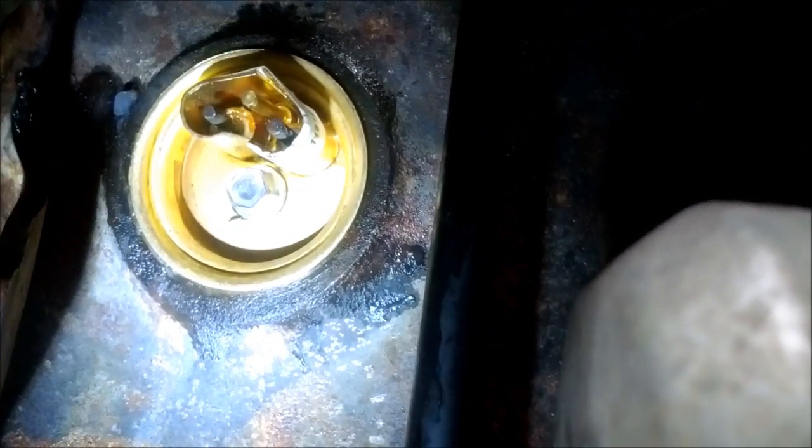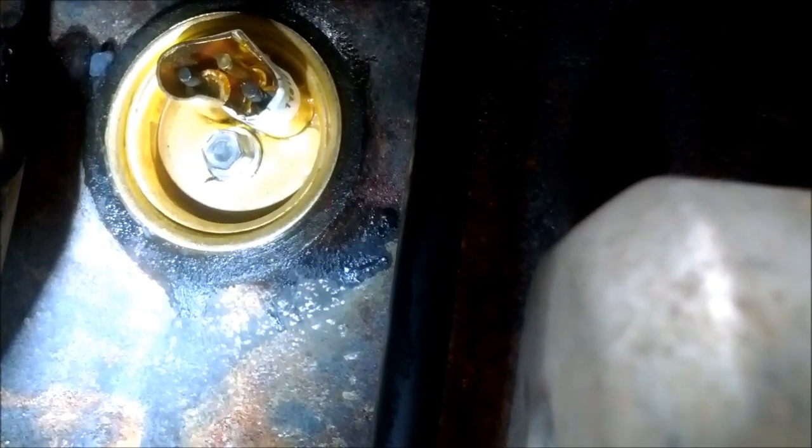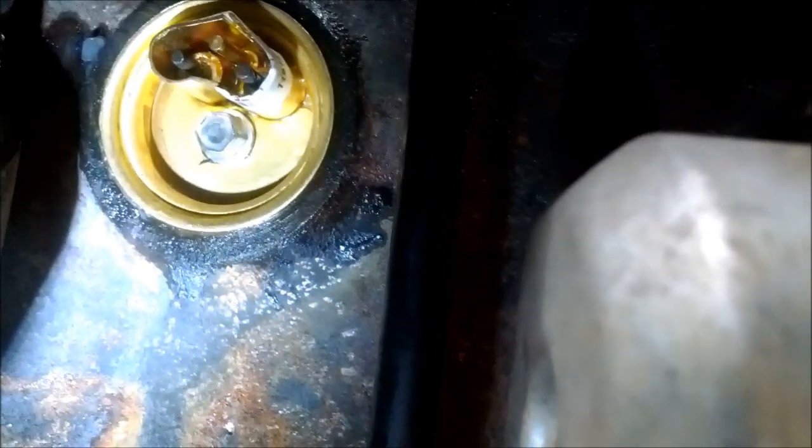And I actually had to back the screw all the way out and push it all the way in, so that it was centered in the hole and pushed in, and then tighten the bolt down. I thought it would just spin since there's nothing back there to stop it, but apparently not. So actually the directions are 100% right. Where are they? Oh, they flew away. But yeah, it says to center it and push it in and then tighten that bolt, and they aren't kidding.